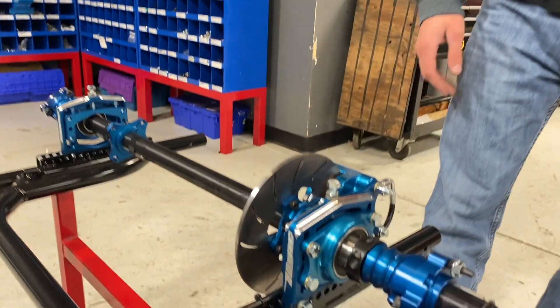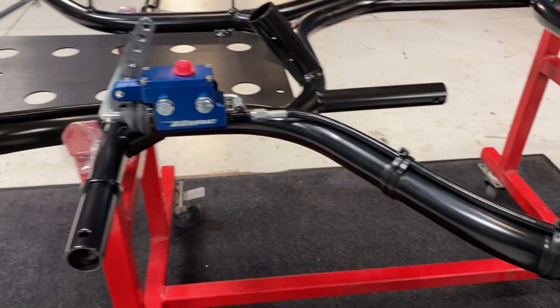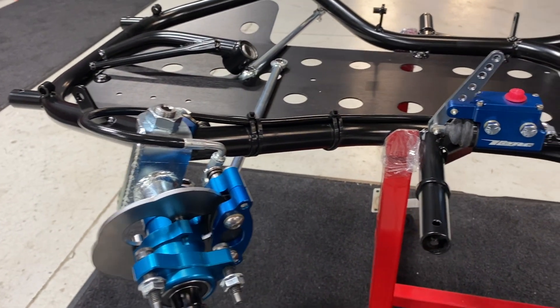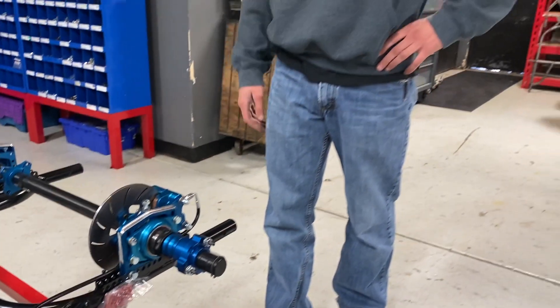Brandon, this looks fantastic. What are some common issues people run into? Really, just do yourself a favor and straighten out your lines to make the car look nice. These brakes are all done in-house — really nice product. Be sure to use liquid Teflon or Teflon tape when putting the fittings on so you don't get any leaks. Straighten out your brake lines and you have a complete system. We'll go over DOT 5 brake fluid in a later video. That's step four — thanks for watching!